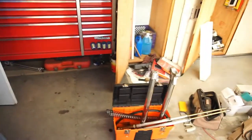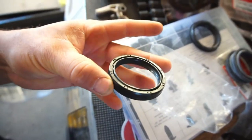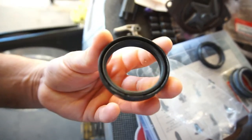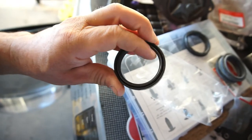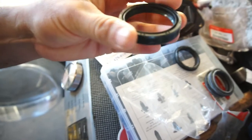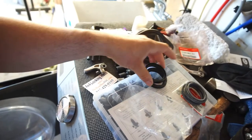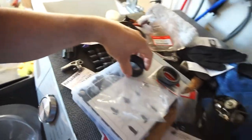I've got too much stuff going on. One of the fork seals — the brake caliper side — was actually installed upside down. They say to put the lettering so the dots go at the bottom, like a normal seal. The spring inside goes inside and stops the oil. When I was taking it apart, the spring was on the bottom, and I was like, 'Well, that's weird — usually the spring goes inside the cavity of whatever you're trying to seal.'